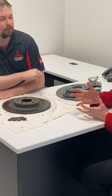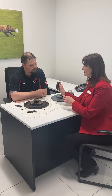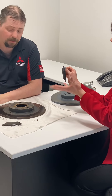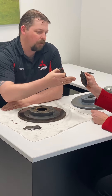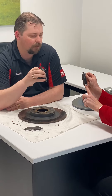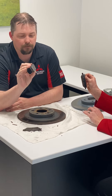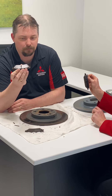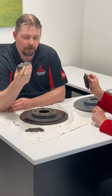A lot of times we'll give you a measurement. When we're measuring them, we're actually measuring the pad — and it's measured in millimeters. We start off with a new brake pad at six to eight millimeters. Below one and a half millimeters fails a motor vehicle inspection on Prince Edward Island, but once you start getting below four millimeters, it's time to start budgeting for new brakes because they're coming sooner than later.